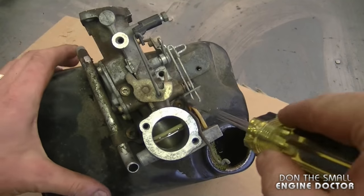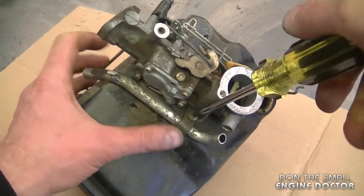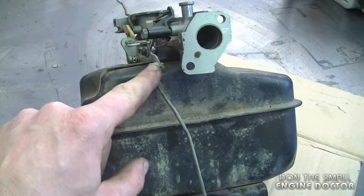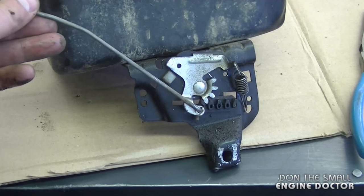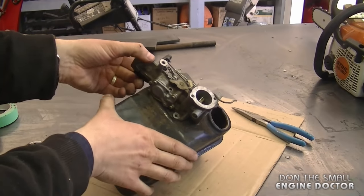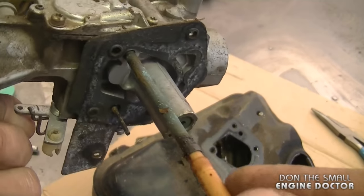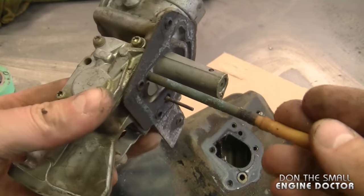At this point it's time to remove the fuel tank assembly from the carburetor. You're going to need the T20 Torx screwdriver — there's a Torx screw over here and another one here as well that needs to be removed. When you remove this one, the little clip that holds the tube is going to come off. Now you'll have to disconnect this linkage from the plastic bushing — grab a pair of needle nose pliers and pull. Also you have to remove this screw over here, which is a much longer screw than the other ones. I'll basically just pry the carb off and pull up gently. As you can see it's very dirty — this is caused by the rust inside the fuel tank.